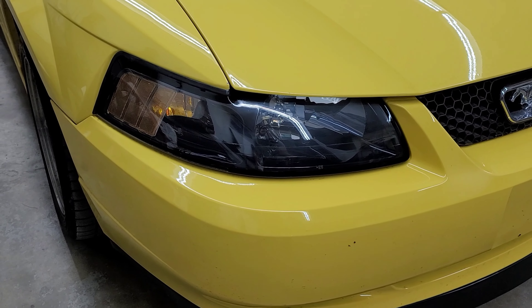I'm going to get my DA and start sanding. I'll do my best videotaping since I don't have a tripod, so I'll try to show you everything in stages. As you can see when I'm sanding, the clear coat comes off like a powder. I'm going to sand the headlight out and show you the next stage.